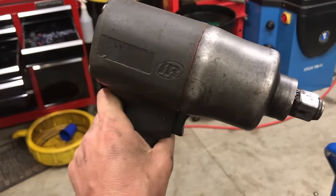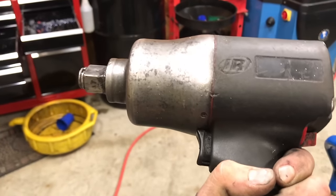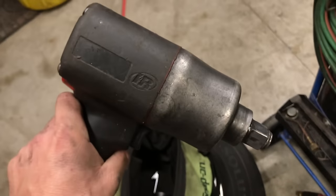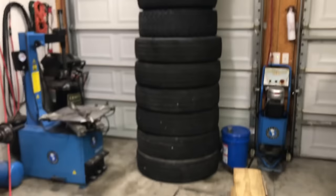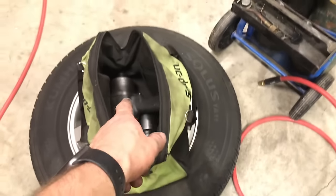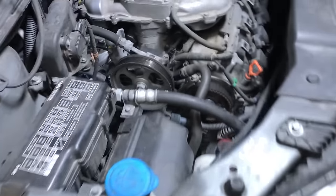And air — by the way, a battery-powered one will not work. You need a big, heavy, professional three-quarter inch air impact to get those things off. I used one while working on a Class A RV doing tires, as you can see them stacked up right there — that's why I had it conveniently, but it worked perfect. So if you can get your hands on one of those and borrow one, do it, because it'll save you so much time and effort and headache.